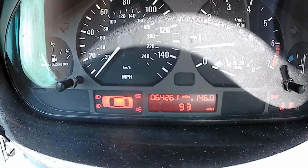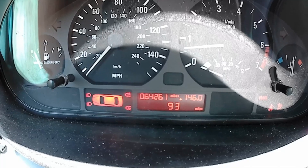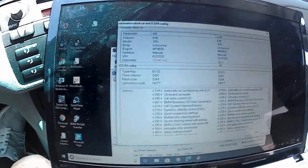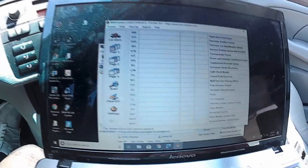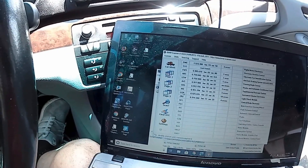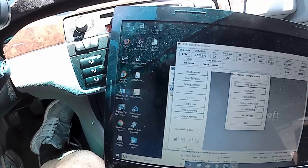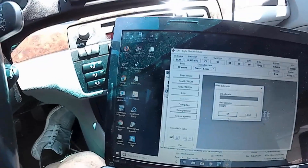I saw the tamper dot is still there. I see the error — in the newer ones you have to type in the mileage manually, so you have to type in the 103,457 km into it. Let's stop it here, click on the LCM button, let's redo the mileage. Reprogramming, then odometer — enter 103,457. Hit OK.